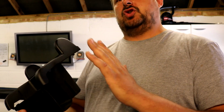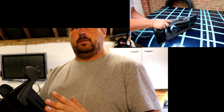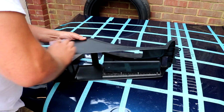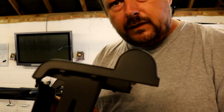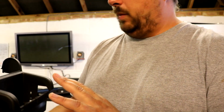So it was a bit of a job to scrape it all off, literally scraping it all off, then using high grit sandpaper, I think P80 or P150, then moving on to a higher grit, and finishing down with a P600, and then primering it, and spraying it with that stone chip paint. It's actually finished down quite nice, okay? Not perfect, but literally good enough when it's all back in the car compared to how it looked before.